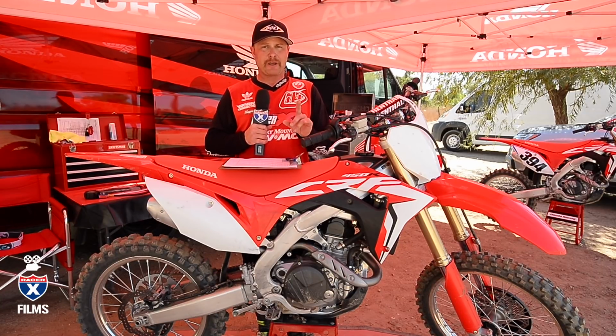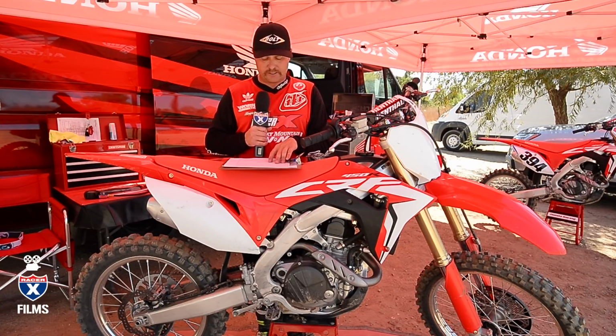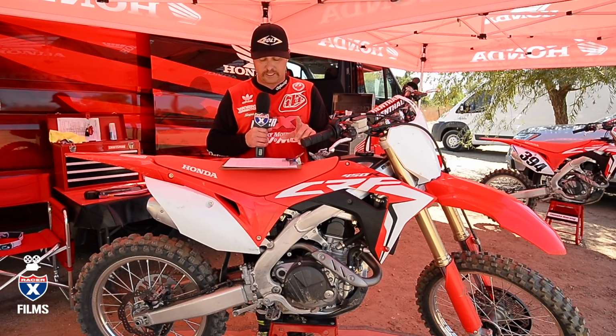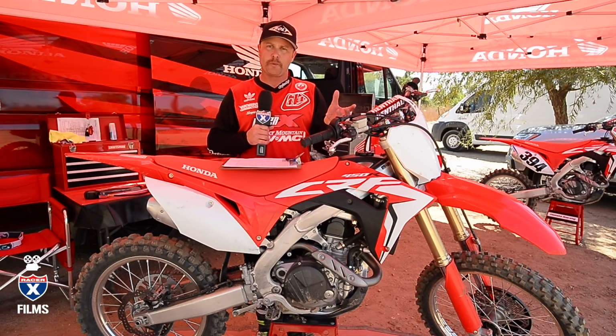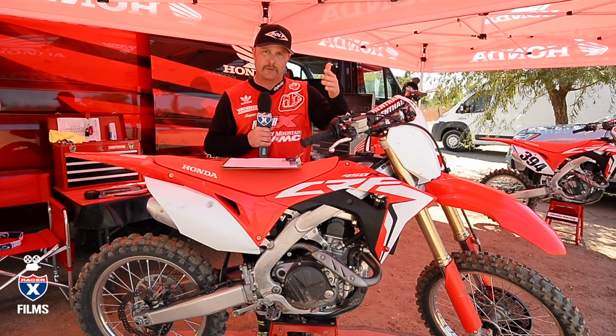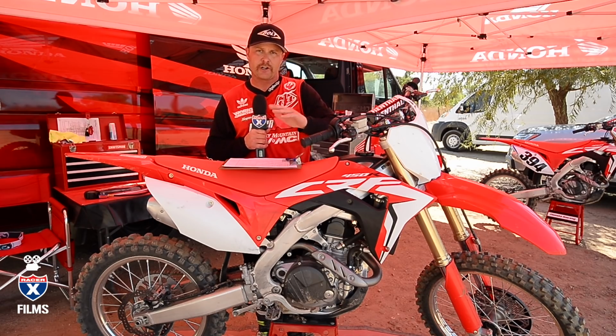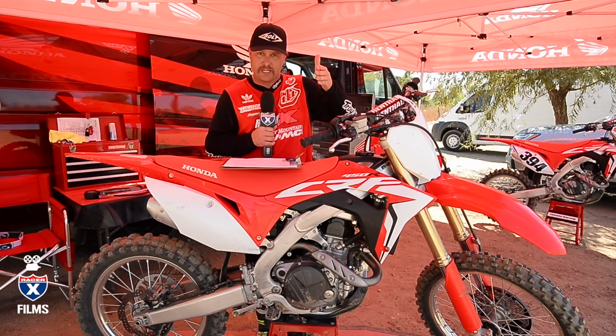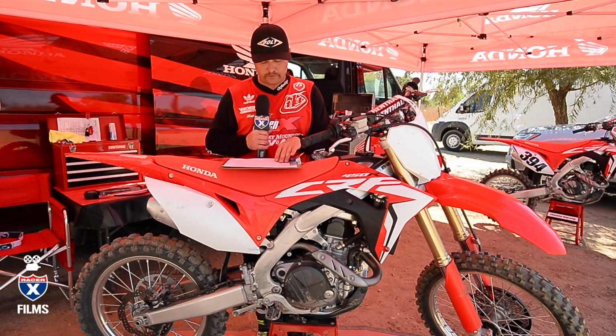The only changes I made, just if you want to try these: my low speed compression, I went to 9 out, so I went a little bit in, 1 click. My high speed compression, I opened up. I'm at 3.75 of a turn out. Again, I was having a little bit of a front end divey feel, like the back end was slightly high. So by opening up that high speed compression, it lets the back of the bike squat a little more. And for me, it would settle into turns better. When I came into turns and I'm on the brakes hard, it didn't want to pop up. It kind of stayed level and made me a lot more comfortable.